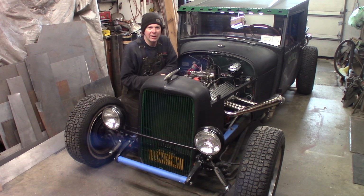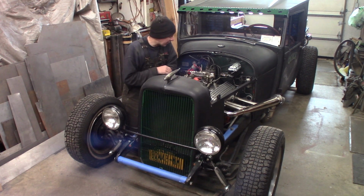I go, yeah, get it back in the truck, and it quit. Just like the key shut off. So I fired it back up, it fired right back up. So I pulled out on the road, went another like 20 feet, and it shut off again. And that was the end of it, never ran again. So I'm almost positive I got an ignition problem somehow. I still got fuel in the carburetor, and it had plenty of gas, so it's not that.